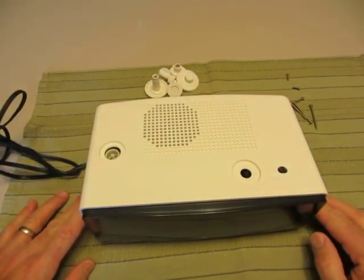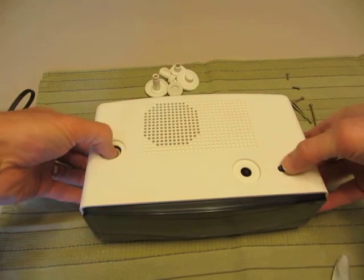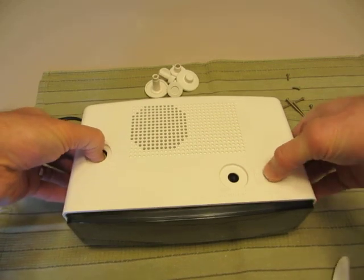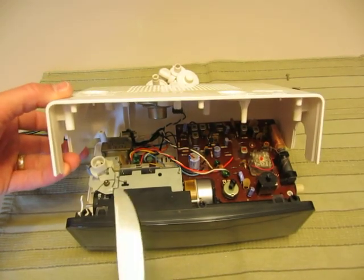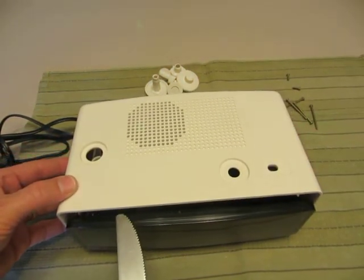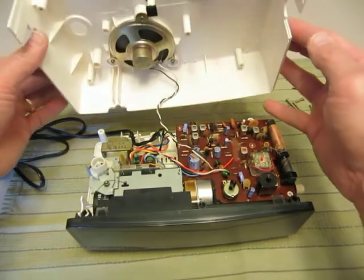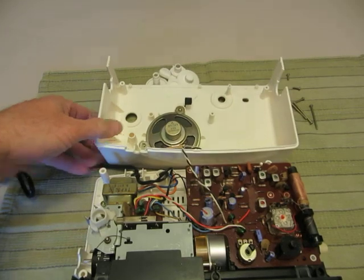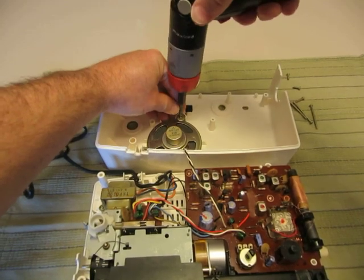If this is an old clock, you're going to have trouble getting the lid off sometimes. The best way to do it is to place your thumbs here and here, lift up with your fingers, making sure you're getting into the seam. Don't force anything — you can mess these things up. Push down and lift up. On the real tough ones, you can take a butter knife and lightly pry. Everything needs to be nice and easy. When it comes off, you'll turn it right over to get to the speaker, because it is connected to the top of the lid.